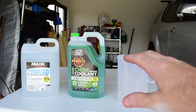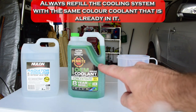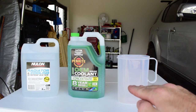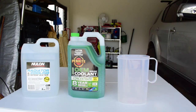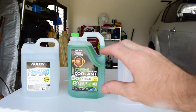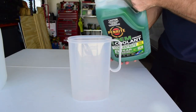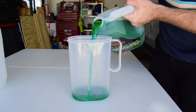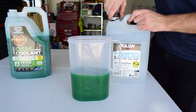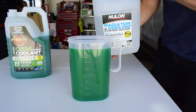It's time to fill the cooling system with fresh coolant. What I have here is my coolant, demineralised water, and a measuring jug. This is coolant concentrate, so I need to mix it with a 50/50 ratio with demineralised water — one litre of demineralised water and one litre of coolant concentrate. Mix it around and then it can go into the cooling system. You can get pre-mixed coolant which is perfectly fine to use, but I find that concentrate coolant seems to last a little bit longer — eight years and 500,000 kilometres. So now I've got two litres of coolant made up and I'm ready to pour it into the system.